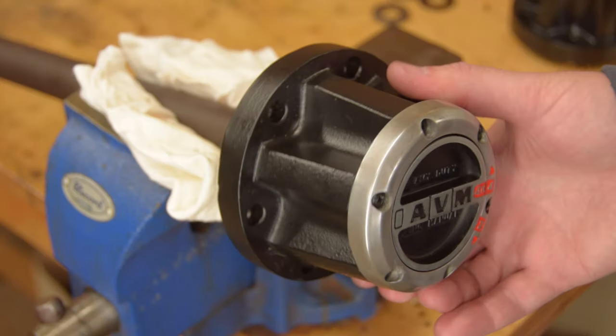The label says 4x4, but you can of course lock them and drive around in two-wheel drive as well — you'll just be missing out on the freewheeling benefit. But if we switch into two-wheel drive mode, or freewheeling mode, the ring gear is pulled back away from the center gear, and now the hub is free to spin independently of the half shaft.